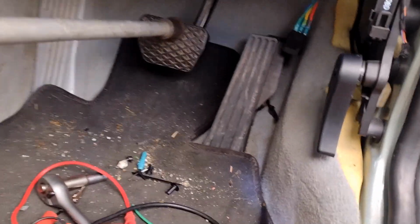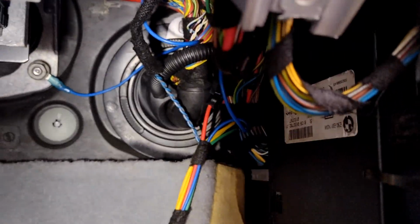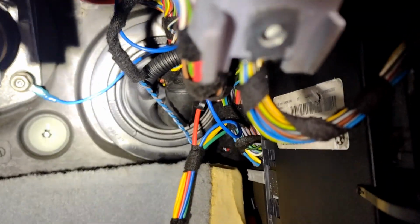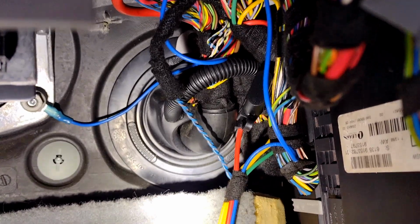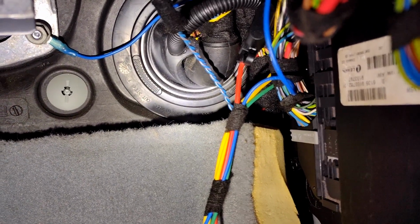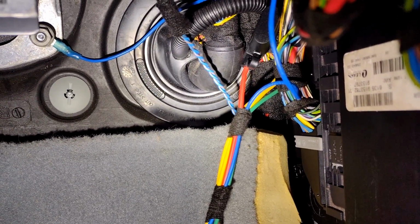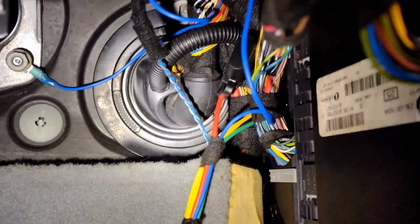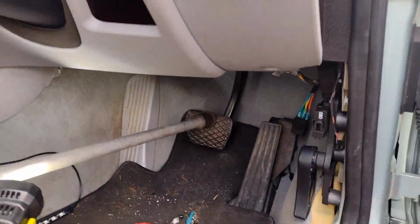Right, I'll show you what we've got here. Basically a relay idea, one wire to ground. The red one goes to a power that's fused over there at the fuse box. This power also has an inline fuse, you see it there? Then we've got the two yellows go to the two brake wires, to the two brake lights I mean, and the green comes from the wire that's going to the high level. So now the ignition's on and the brakes are pressed.